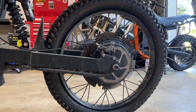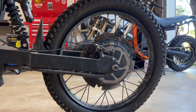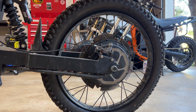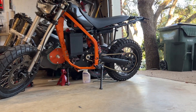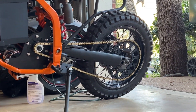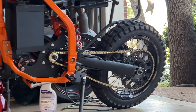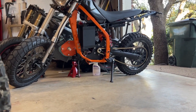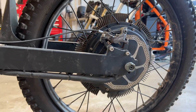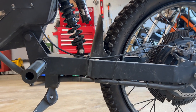That's one reason why hub motors are not convenient. I think ultimately the systems in the bike should be modular and each serve a purpose — the motor should do its motor thing, the wheel should be a wheel. On a standard motorcycle, it's very easy to change the wheel: you just take the chain off, remove the wheel, and it has nothing to do with the motor or phase wires. But on this bike I have to deal with all of that.